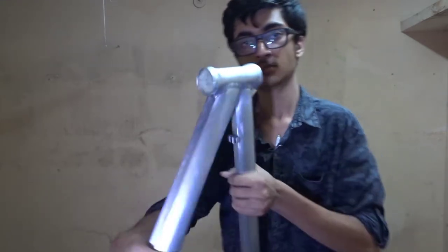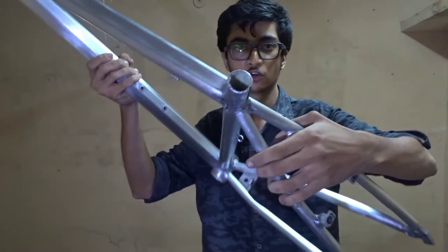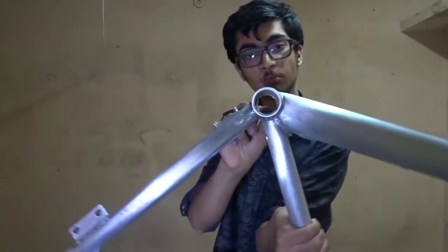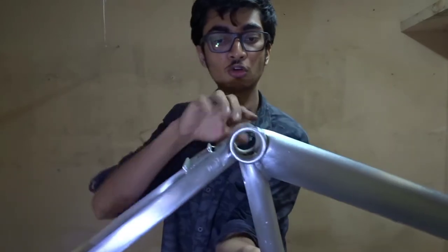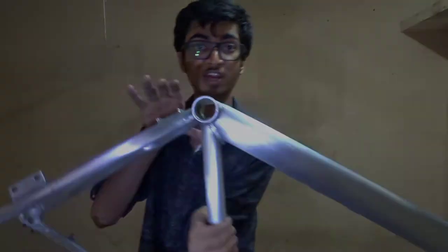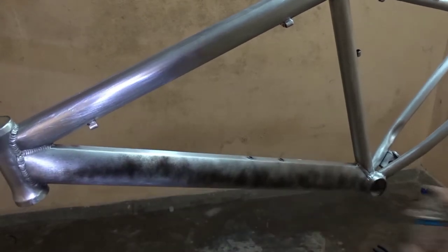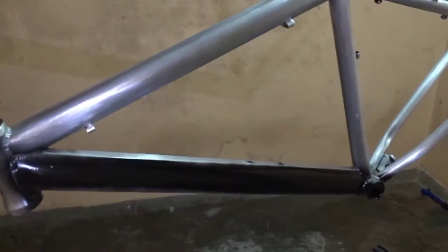Now there is a main thing — I have taped up the head tube on both sides, and even the seat tube, because the seat post needs to go in and I don't want any kind of resistance. Also the bottom bracket I have taped, so we don't want any kind of paint on the threads. While you're spraying, make sure you don't over-spray or else that might cause wrinkles, and that is really bad.